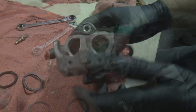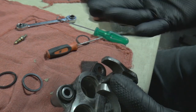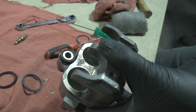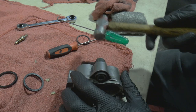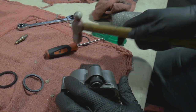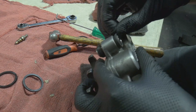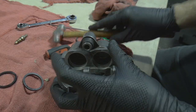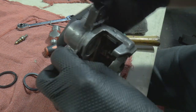Once the lands have gotten as clean as you want them — mine are really clean, I can feel with my glove off they're really smooth on the inside of the bore, no more debris. Now this floating pivot is going to be a problem. I try to take one side of this seal off and keep forcing it out — look at that, everything is rusted.